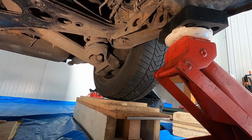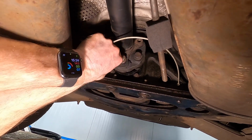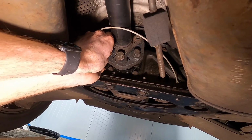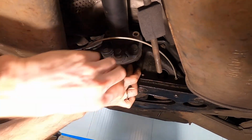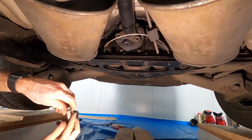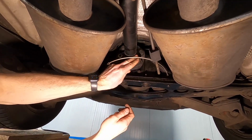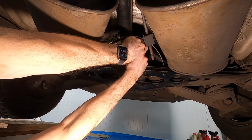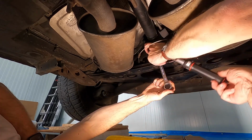So with one rear wheel jacked, it's free to move the hardy disc or the prop shaft. So now we are able to turn all the bolts into the pinion shafts and the prop shafts and the hardy disc in between. Okay. Now let's move some more. This makes it easy to work on. All right, so let's torque it to 81 Newton meter.